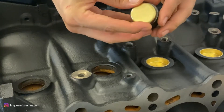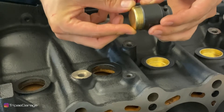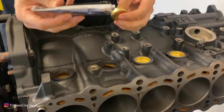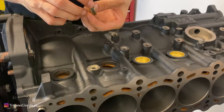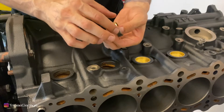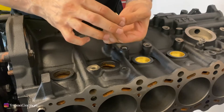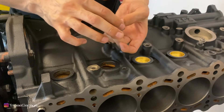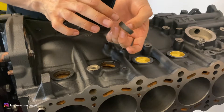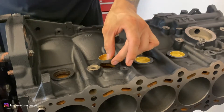If I turn around and show you, you can see there that it makes contact with that outer lip — the part that you're going to want to be hitting. The first step you want to do is get yourself some RTV silicone and apply a light coat all the way around, then go ahead and set it in place.